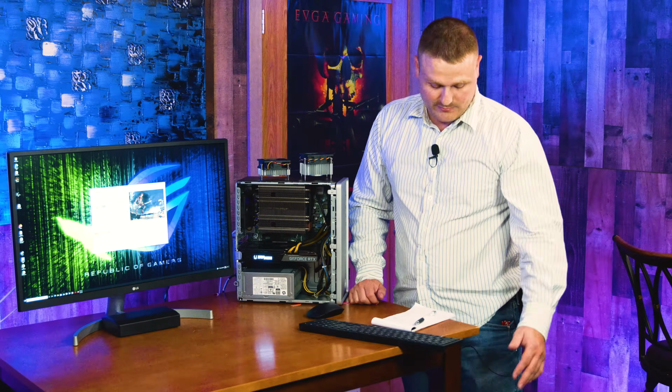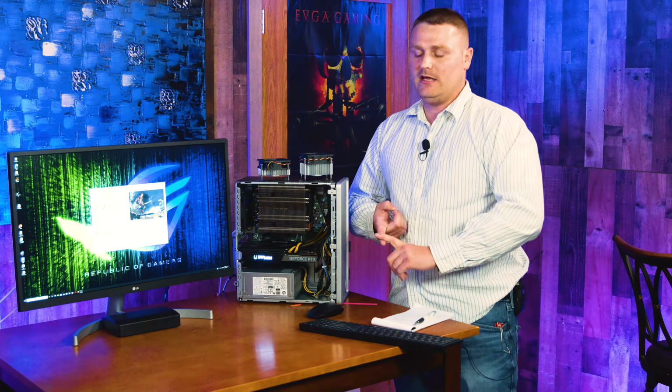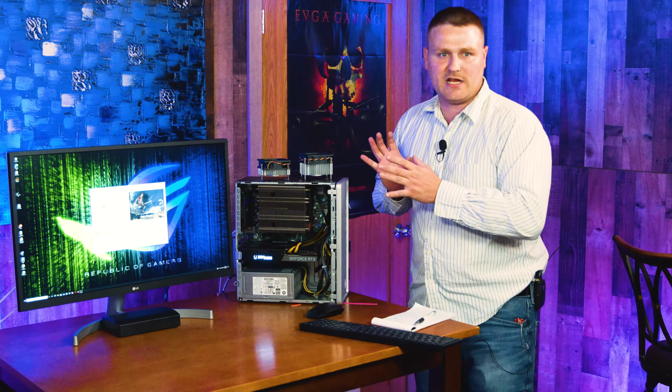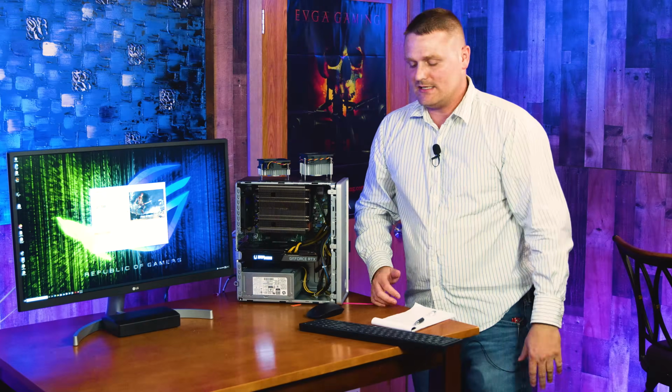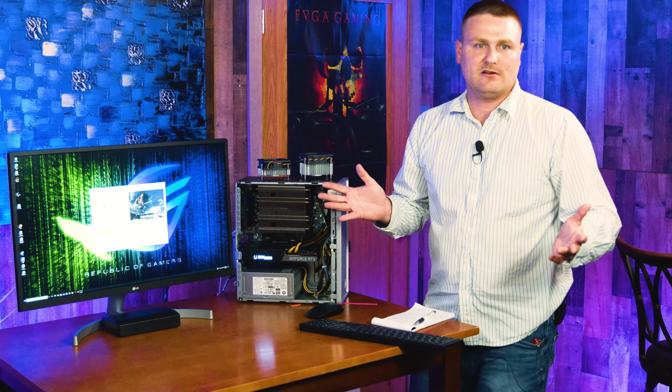And of course, we're not even going to talk about an RTX 3070 right now because the price of that is just... It does not come with dual channel RAM. You are going to want to do that. Either order it from the factory with dual channel, or you're going to want to put it in there. It's like having one garden hose this size and adding two the same size next to each other. Even if you go down into a slower speed of RAM, it is still going to be better to have dual channel. It's not the capacity of RAM, it's actually the pipeline the RAM, the processor, and everything uses.